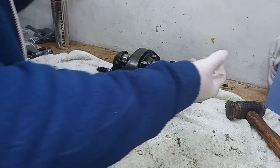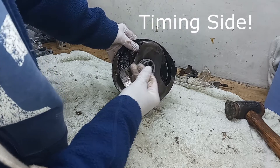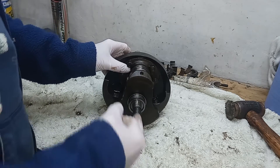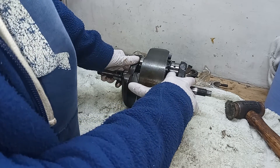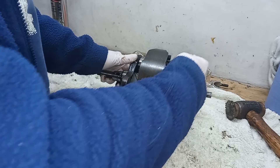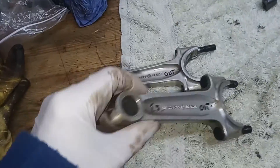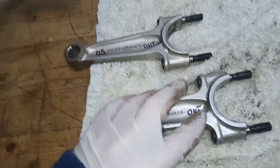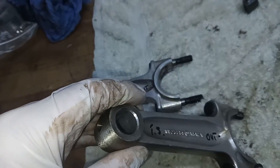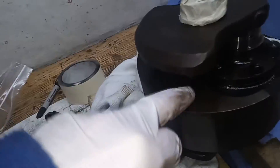I think that's where I'm going to leave the crankshaft for now, once I've put tape around these bearings. There's a big pile of oil there because I was standing the crankshaft up - on the drive side, the drive side is hollow and that's where the oil goes straight from the oil pump down the crankshaft. It comes out of the big ends - those holes in the big ends are where the oil goes first. There's also a drilling in the top of the conrod.